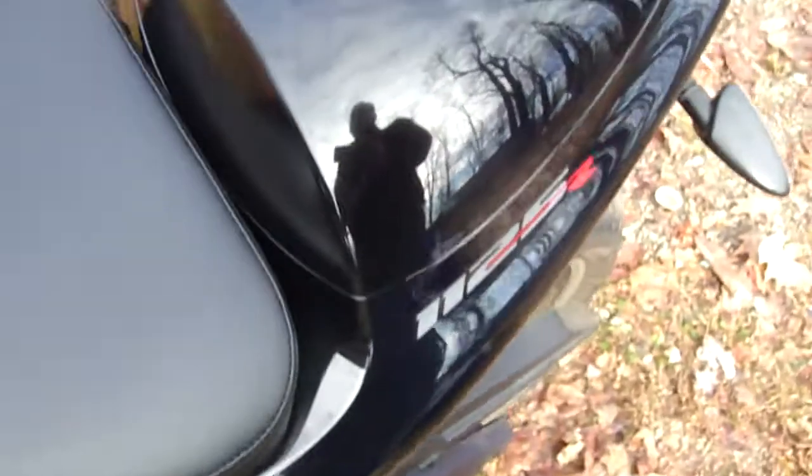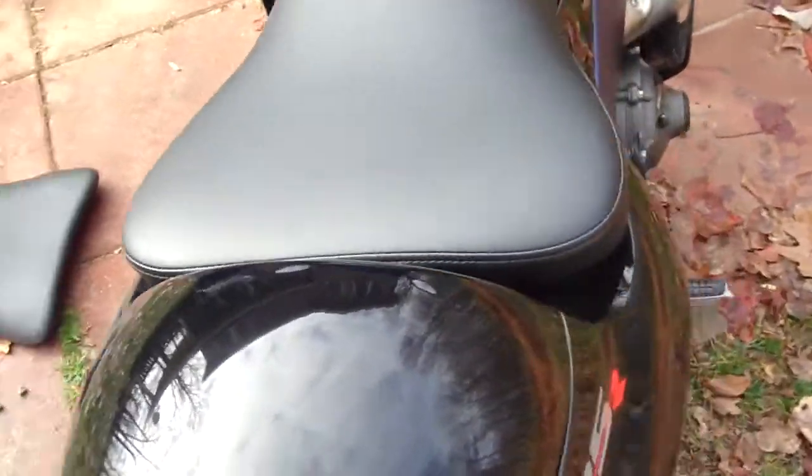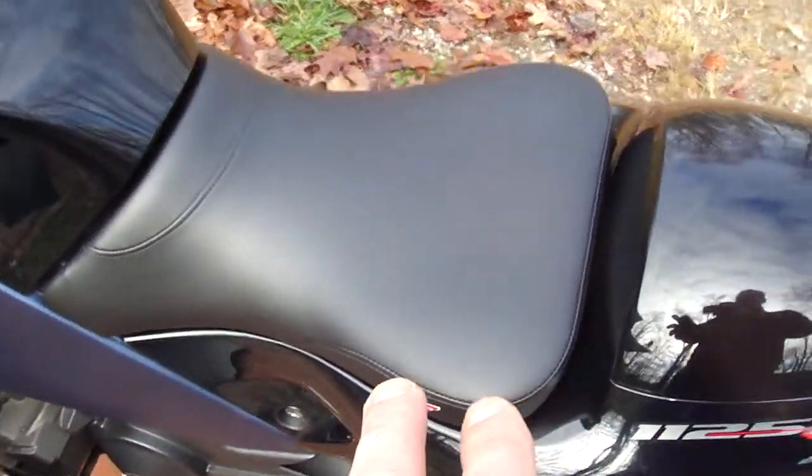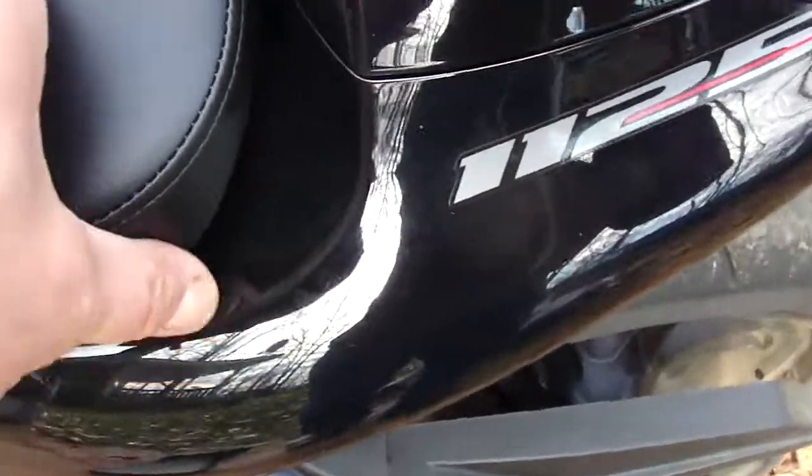It's got a curve in the back and it's a little bit longer. And you'll see on these seats, it doesn't follow the curve of the cowl quite like the stock seat does. You'll notice that there is a gap in between the tank and the seat, which you can adjust to a certain degree by elongating the holes that attach the seat.